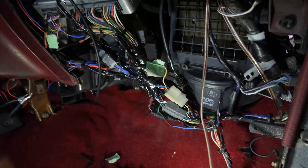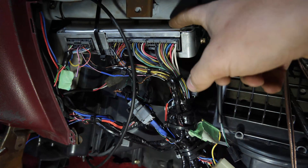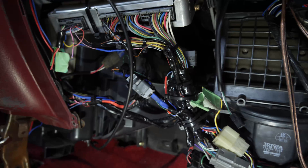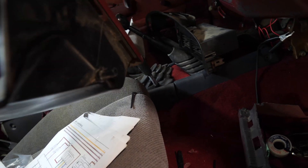Everything's got plugs so that I can disconnect it all if I ever had to pull the engine — nothing is hardwired into place. With this setup I do have the computer tucked up in the dash, because this ECM is so much bigger than the factory unit and there is not a chance it's going to fit inside the kick panel. The downside is the glove box won't fit, so I trimmed the back of the glove box trim piece and the glove box itself, getting rid of the cubby portion. I'm just going to have to live without a glove box.